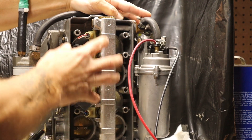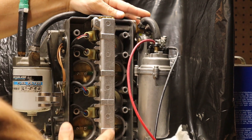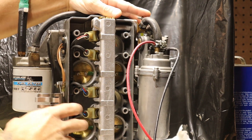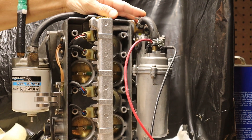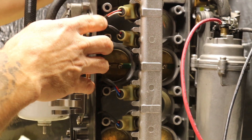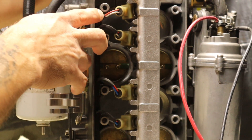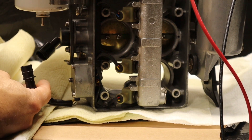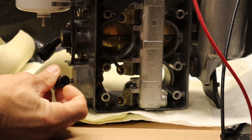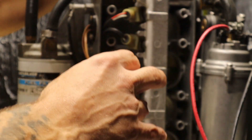All right guys, you see here — this is a fully assembled laser intake minus the plenum cover, which has all the bolts that attach it to the reed plate on the intake side. Once you pull that cover off it's basically free to come off the motor after you disconnect fuel lines, electrical lines, linkages, and so on. You can see all our injector plugs are exposed. Looking closer, we have a common wire color across all six plugs — that color is red. Red is our common, so I'm going to follow red down to the plug and figure out which pin my red is. That's the pin on the corner — red is negative.